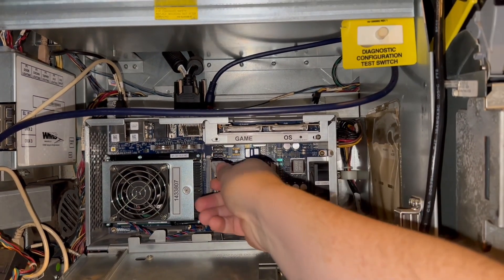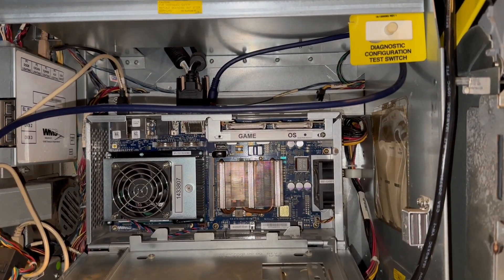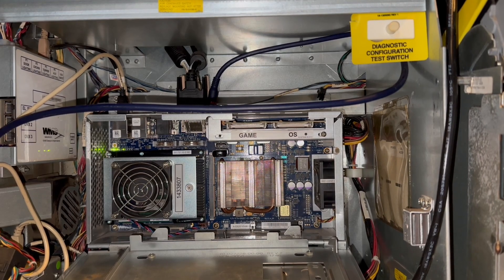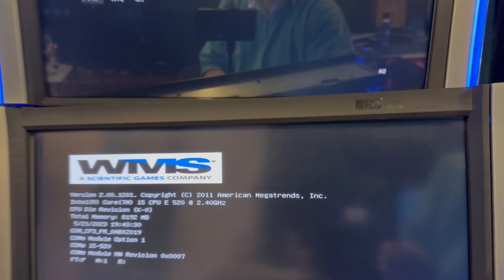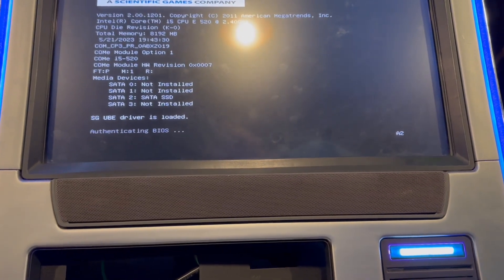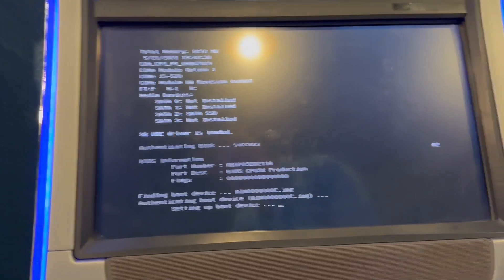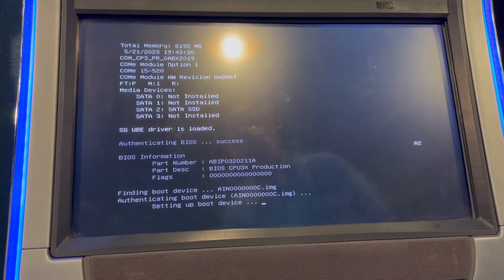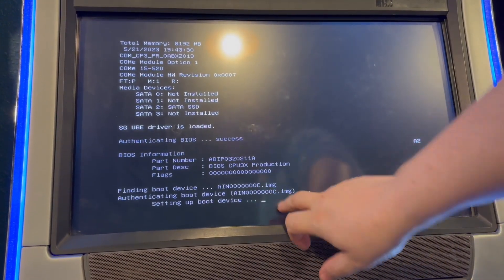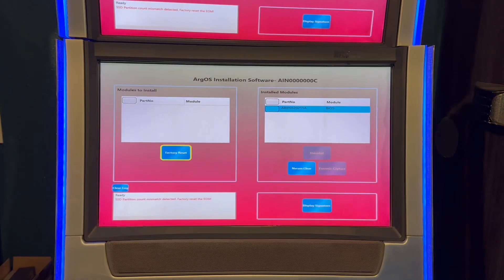You can put that into any USB port, but there are some convenient ones right here on the board. Stick it in there and power on. Now, if you just get a blank screen when you turn it on, that means you did not put the BIOS chip in all the way or it's not correctly installed — just go back and do that again. We'll wait for this to boot.